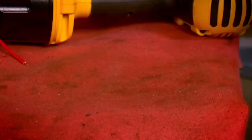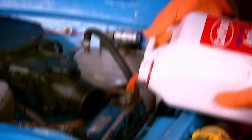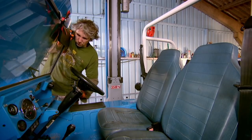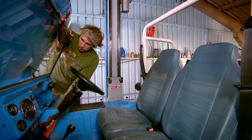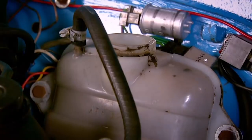The fan needs power, so with the battery disconnected, I cut one section of wire to length, attach one end to the relay, and the other is connected to the Moke fuse box. Now I top up the coolant using a 50% antifreeze and water mix, and we're nearly in business. I need to run the engine up to temperature so the mechanical thermostat will open, then any air trapped in the cooling system will bleed out through the expansion tank, which I'll leave open for the time being.